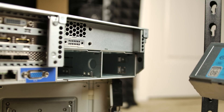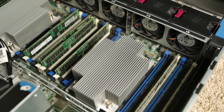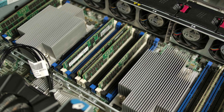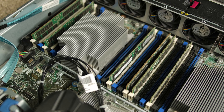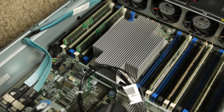For my server, I found an HP Enterprise unit — a ProLiant DL380. This is a Gen 9 server, which started to come out all the way back in 2014. I know when you think of a decade-old computer, you probably think it belongs in the dump, but this has plenty of life left in it, especially for my purposes. This unit has two Xeon processors, each with eight cores, and they're hyper-threaded. They might not be what you're looking for in a gaming computer due to the lower 2.6 GHz clock speed, but with a total of 16 cores and 32 threads, it will be great for the parallel tasks you often have in a server.